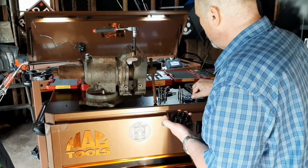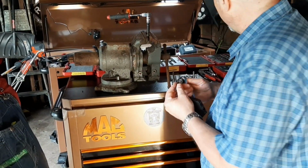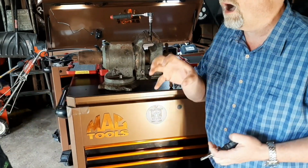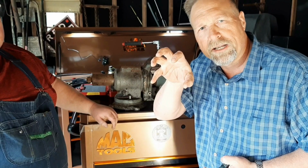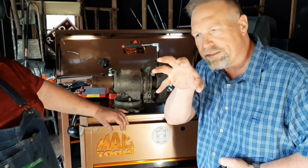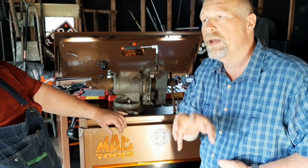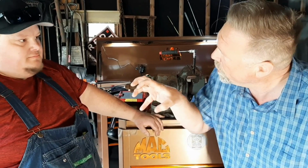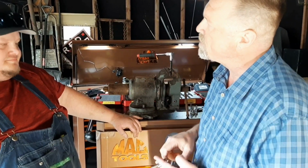And as it clicks out, it removes metal and it just gets worse and worse and worse, right? Yep. So the design of our Torx head, there are little tips, hooks machined into the ends of our Torx bits, and you can see them if you look at a big one. It's subtle, but it's effective. Okay, and what that does is when you tap ours down in and those little hooks engage into the corners and it stops it from camming out. Right. That's why we get good ones out, but we can get those compromised ones out too.